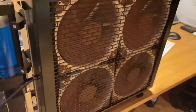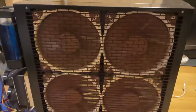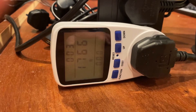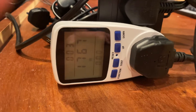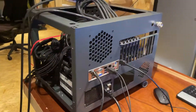Those rising temps in turn will make the fans ramp up, because the fan curves on the pumps are driven by coolant temperature. We can't break about 30°C on the coolant, which is really good for GPUs of this power. Looking at the power limit over here — using one PSU here, the Molecule normally ships with two 1600W units, but we wanted to test one 2kW 8Pack cable and see what it did. You can see we're nearly hitting the PSU limit, but for testing purposes this is fine for six 3090s and a Xeon W-series.